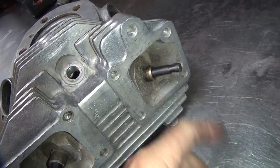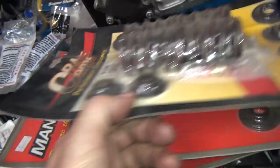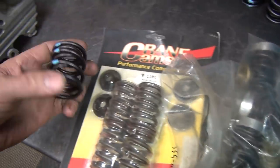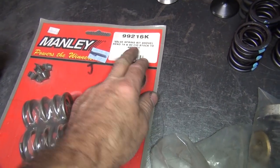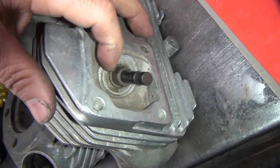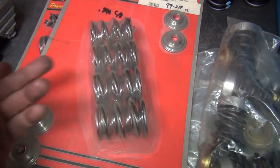There's a lot of clearance over here because they're sunk a lot, so you don't have to put a real high-lift collar in it. I've got some different valve springs to play with - some old 70s/80s style racing stuff. These are like Sportster springs that fit the big twins. Here's some Crane - high-lift stuff. These are actually EVO Crane springs. This one here is for 465 lift, but when the valves are sunk like that you'll go up to 100 more. If you take the lower collar out - like there's no lower collar with this one, you just have the spring sit on top of the washer - you pick up another 80 or 90 thou more clearance for bigger cams. Here's some titanium stuff - also 465 lift, and these don't use the lower collar so they got more clearance.